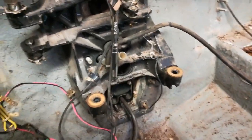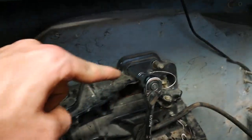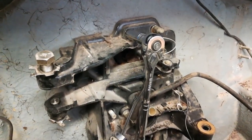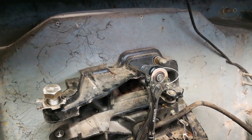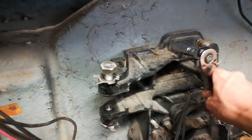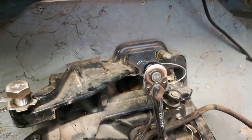I've got most of the nuts off all these bolts. These top two are the only ones left. The only thing kind of difficult about these is that they're starting to turn the bolt with the nut as I'm unscrewing. So what I'm going to have to do is leave one of these nuts with the ratchet on it in here — it's a pretty big, heavy ratchet so it shouldn't turn — and if it does it should get caught. Then I'll unscrew it from the outside to get it the rest of the way off.